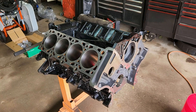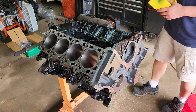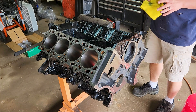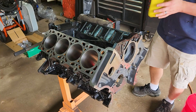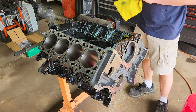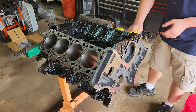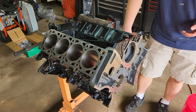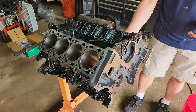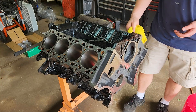The other thing I'm going to do here is — since this was machined and I don't believe the machine shop washed it — I'm going to take the cloth and on a new clean surface, clean out the cylinders and get out all the dirt. This could make or break an engine. We want a new engine build to be as clean as possible.